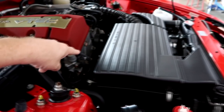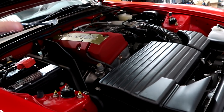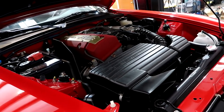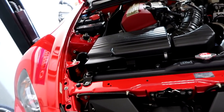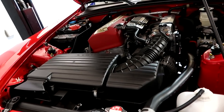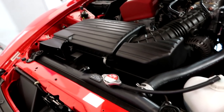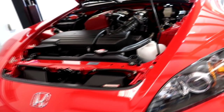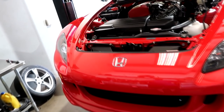We have plans for this car, so that's going to get done with the next plan. Also, spark plugs — if you're not boosting the car, the plugs that come in are good for 100,000 miles. However, I would check them. Anything after 60,000, check the gap. Spark plugs are not that expensive — I would replace them if they're questionable. You didn't buy this car to be cheap. You bought this car because it's an enthusiast car. You love the car. This is part of the passion of owning it — to keep it absolutely tip-top.